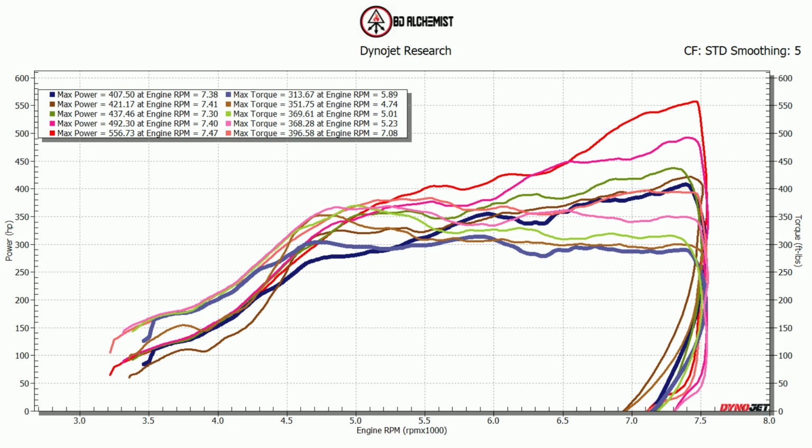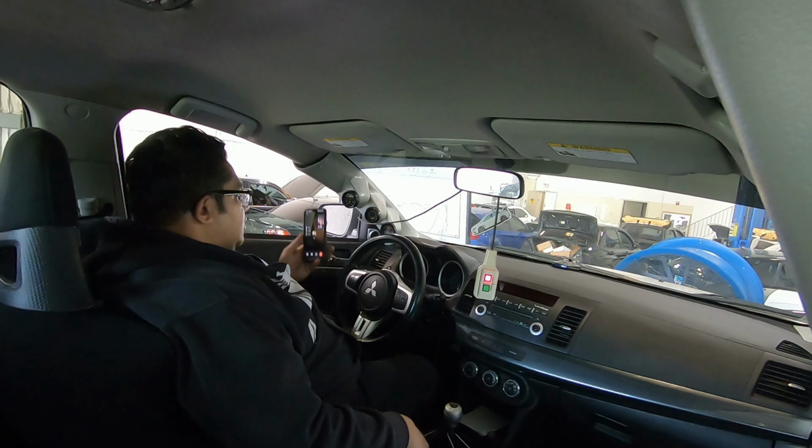So I was aiming for a 32, but I was really 30, 31, and as you can see, the turbo's in its efficiency. Really, a couple of PSIs is making a big difference. Also, his boost gauge is not reading right. It's reading low, but the Omni 4 that I'm logging is reading 30, 31, and so are my logs, loads and everything. So this is basically what he asked for, but just for kicks, I am going to put the car to just one run on 35, 36 pounds, that I know the motor can take, and where I would be at if it was my car.